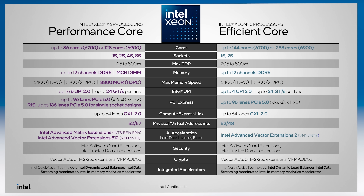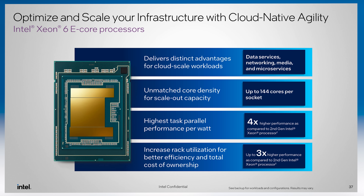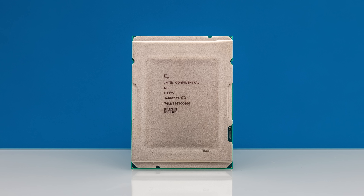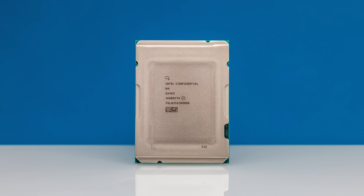Let's talk about what it means to be an E-core versus a P-core in this generation. A lot of people think E-cores just suck, like they're from the old Atom line, but the Crestmont cores are actually pretty fast. They're more equivalent to something like a late Xeon E5 or early Skylake in terms of performance, as long as you're not looking at AVX-512. These are actually pretty fast little cores, and Intel has a ton of them.